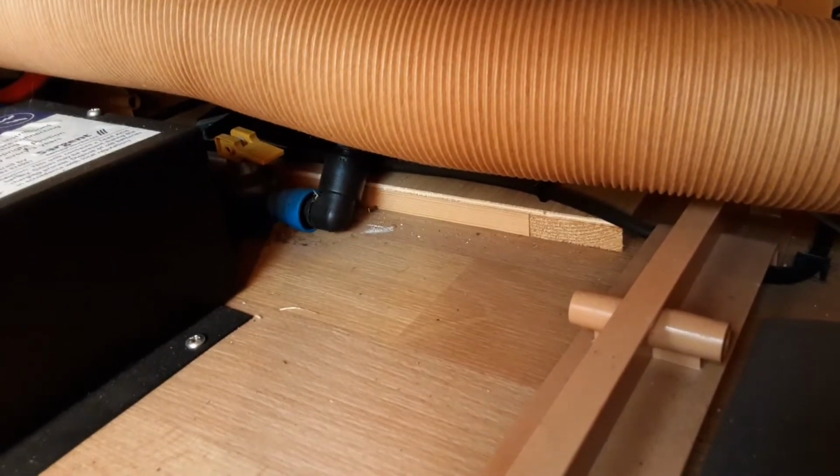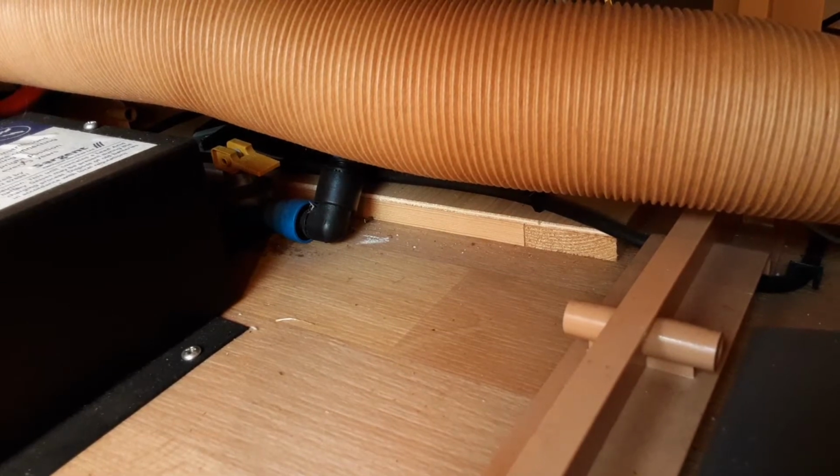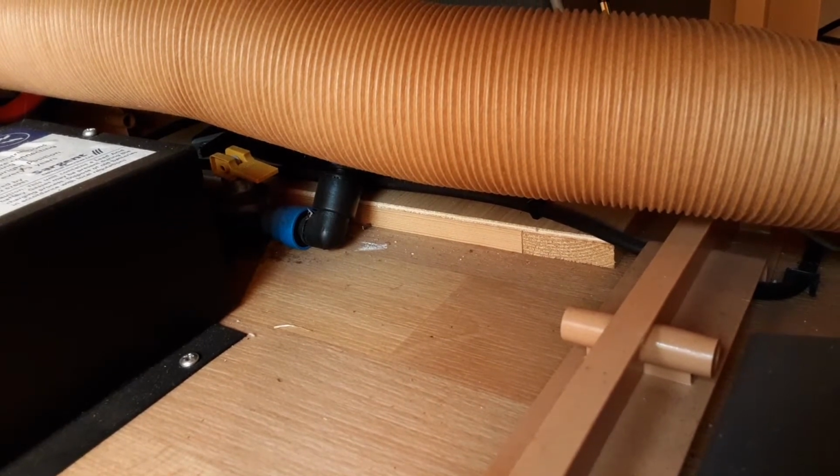So to fill the water system on this particular caravan, you can come underneath the seat on the front right hand side. Please bear in mind the caravan hasn't been cleaned yet. We're just getting the video done, so it's over to you before the weekend. But as you can see underneath the seat there, you've got the yellow drain down valve for the water system. To fill the water system up, you need to make sure that valve is parallel with the floor.